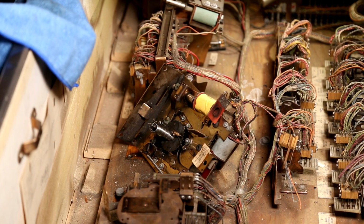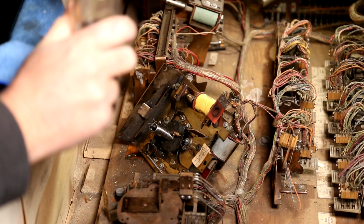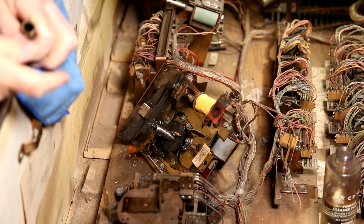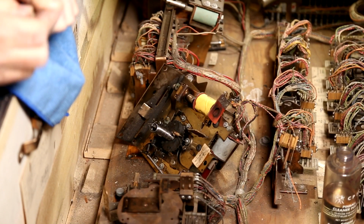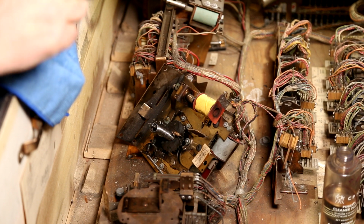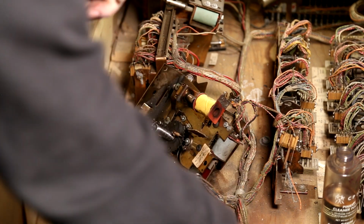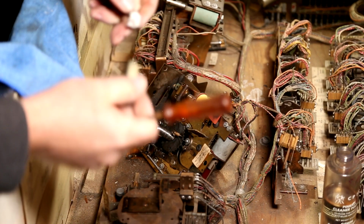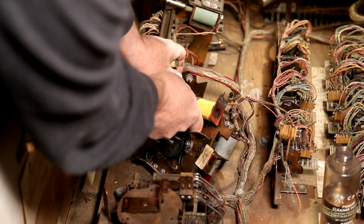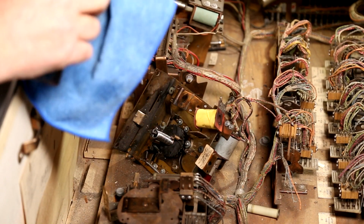A lot of people like to replace these little sleeves. Yes, I've seen them in the parts. And I don't replace them that often. Just if they're not super damaged, then I don't bother. They get brittle. I've noticed that they get very brittle. That one that we were working on the other day was brittle. I've had a few where the coil will get stuck on or something, and the heat will malform them, and then they're nice and tight. But if this runs through it without resistance, then I just leave them alone. That's pretty sticky. That's probably where our problem is.